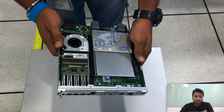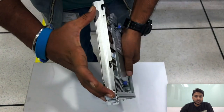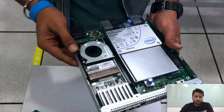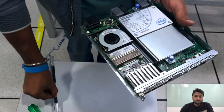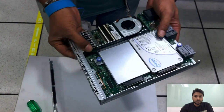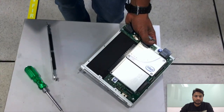To remove the PCI-based card you will have to remove the side cover as well — there are three screws which we need to remove. Once the screws are removed, remove the side cover. Then push the card a little and it will get removed from the PCI slot.